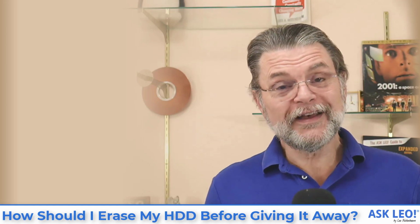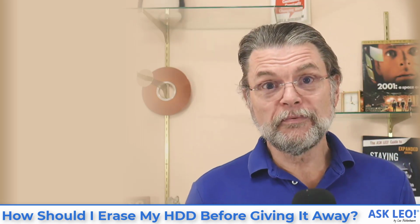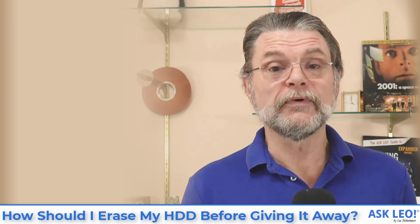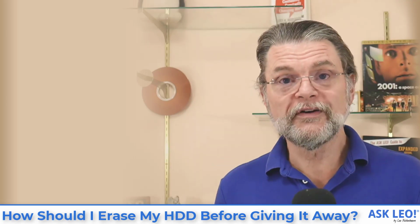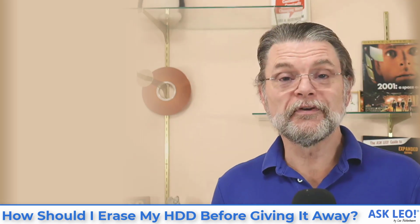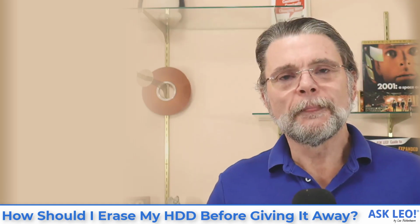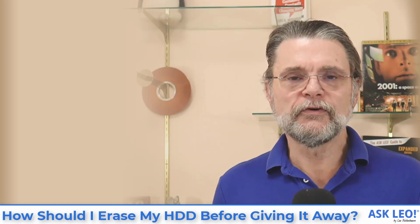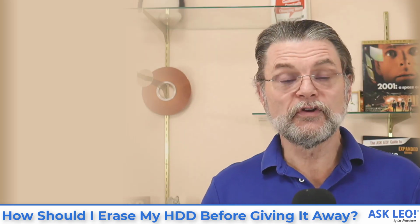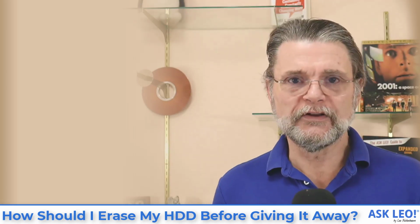Now, this does kind of throw a monkey wrench into the idea of giving your computer, giving the technology to another source or another place for them to be able to reuse. Once you've destroyed the hard disk, the hard disk isn't going to be reused anymore. The rest of the computer might be, but of course, the first step they're going to have to do is get a new hard disk. So my honest recommendation is to use a tool like DBan on real hard disks. Use a tool that is specific to your SSD if you're getting rid of a machine that has an SSD in it, and call it good.